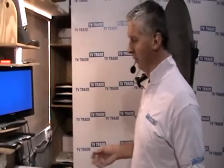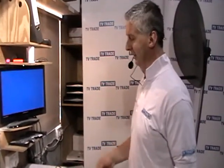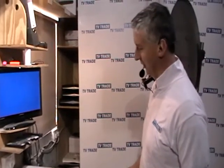On the back of some televisions you can have a number of different AVs — AV 1, 2, 3. So set that to the AV input you've actually used in the back of the box, and automatically the picture will pop up. Virtually all televisions come with scart connections on them.